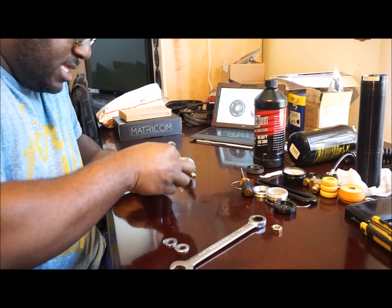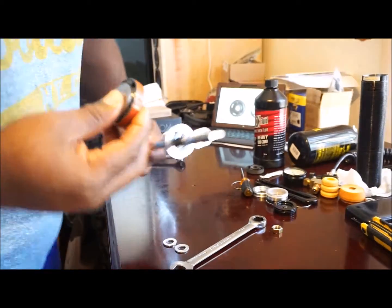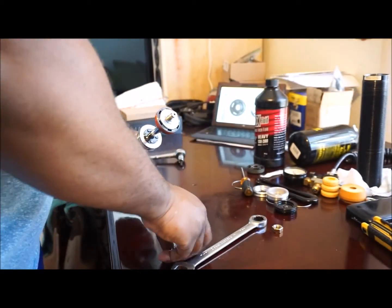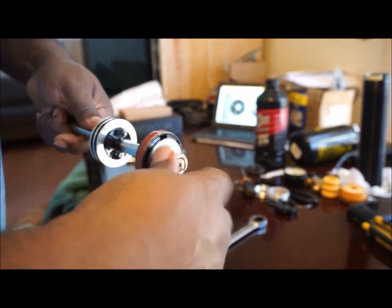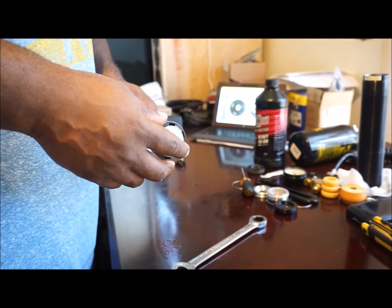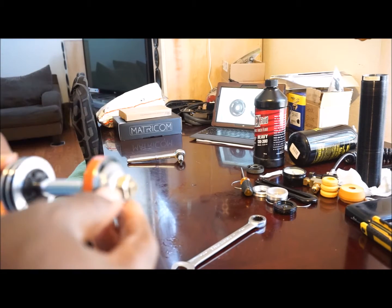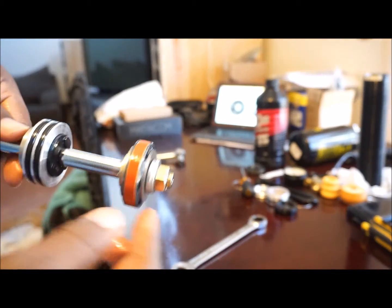This is a BC Racing BR shock but I changed it with a Bilstein 46-millimeter piston and Bilstein internal parts, except for the shims — the shims I got from SDI, Suspension Direct. Type in Google 'Suspension Direct SDI' and you'll find their website — they have quite a few shims. I also list on my post on Club Lexus quite a few other sources for harder-to-find shim sizes not on SDI. The purpose of reopening this is to show you guys the piston and also to replace the bypass shim.